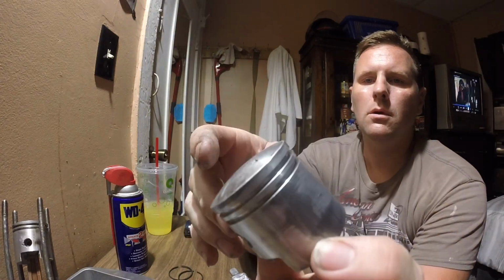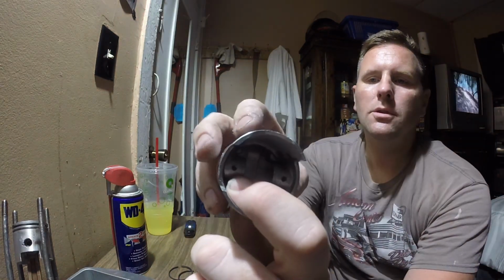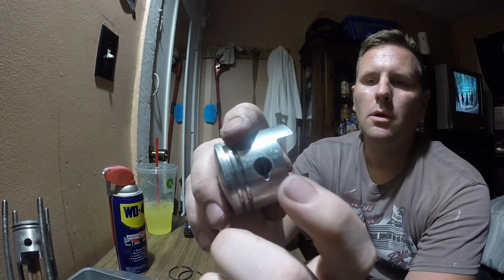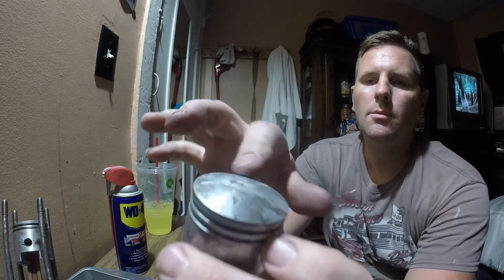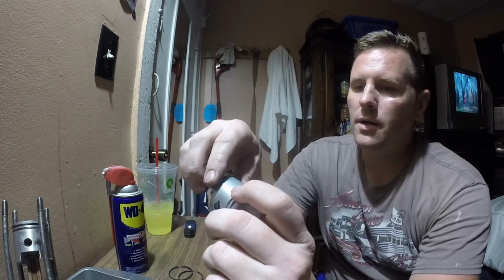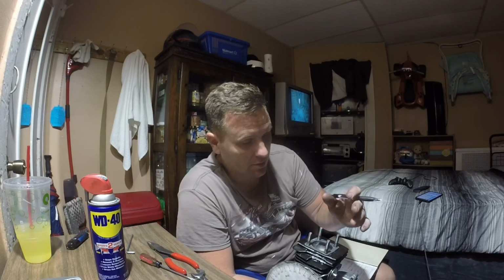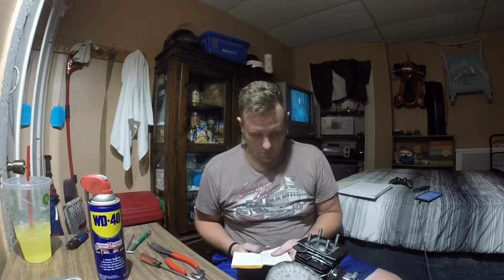Okay, all cleaned up. Did the oiling holes, made them slightly larger, pushed them all the way through. I recessed it, cleaned up all the carbon on top. Let's go ahead and get her in. Okay, I got it back to where at least I'm back to assembling, which is why I tell you, this cylinder, they're all different. This cylinder 100% was a good little runner.